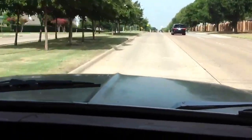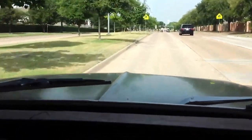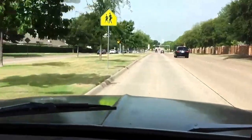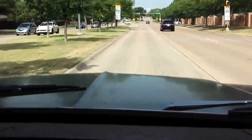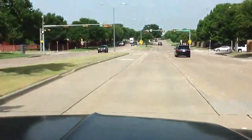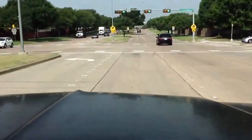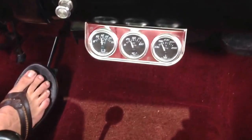If it does not have a 3.0 gear ratio, if you have a 9-inch rear end with a 273, that might be an ideal gear ratio for this truck if you end up driving it daily. Then you'd probably do 65 miles an hour at about 3,000 RPM. A little more manageable, probably 500 to 800 RPMs lower. Save you some gas.